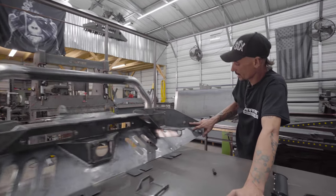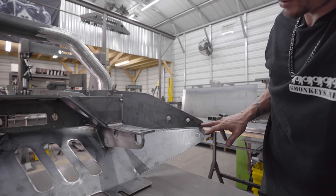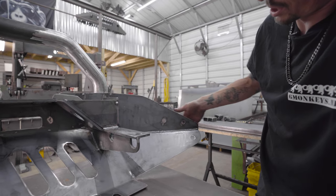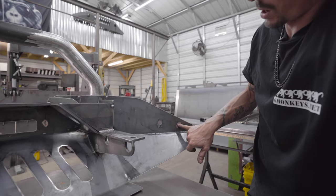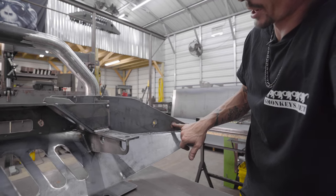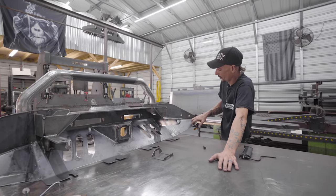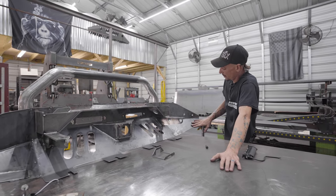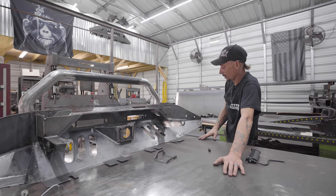These couple of holes over here will be covered up by your factory fascia. These holes are for if you have Quadro Lift — you'll have a compressor up front. Once you remove the factory crash bar, you'll have two bolts and you'll just bolt it right into the front lower guard. Secures it, good to go — really easy.